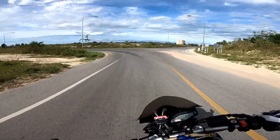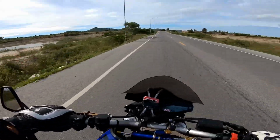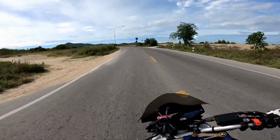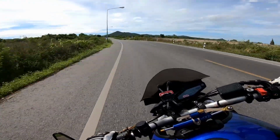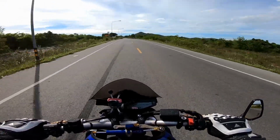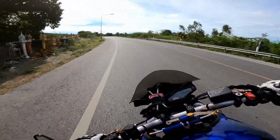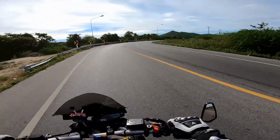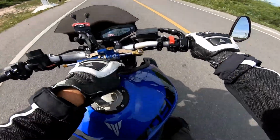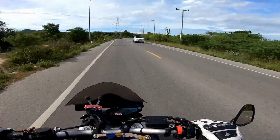The parts came, and yesterday I had to take the fuel line off again and disassemble everything. I had to slightly move the airbox, basically taking it off to access the fuel line at the other end. Not a nightmare job, just fiddly, because you've got to take all this plastic off the front, and all these rubber bits and poppers. Anyway, take the tank off, take the airbox off, put the new fuel line on.